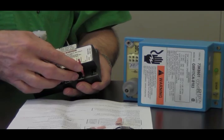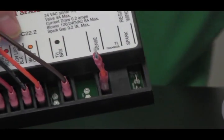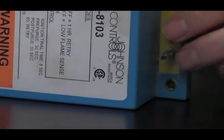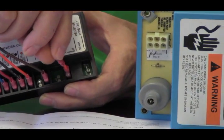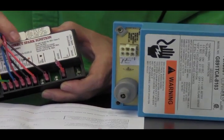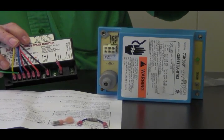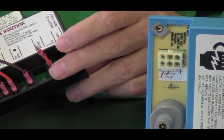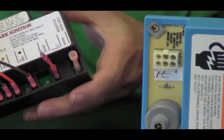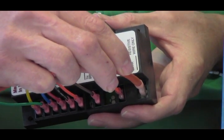We have a little wire sticking out here for our flame sensor — it says 'sense' right here. Our flame sensor lead on the old control was right up here, so we'll just unplug that and re-plug it onto this connector for our flame sensor. For our igniter, we're going to strip the ends of our ignition lead, tie it into this connector, and then plug it into our spark terminal right here. It just slides on like that, and that'll give us our spark.